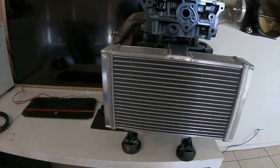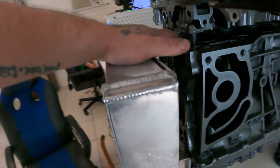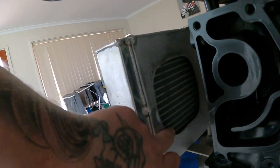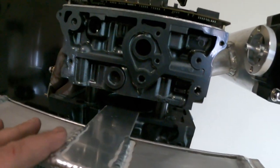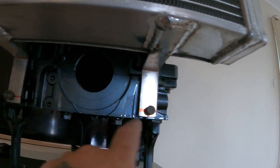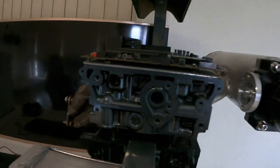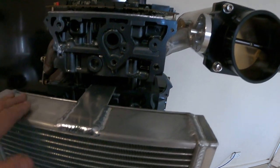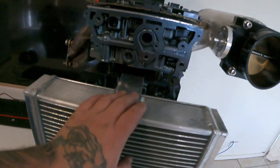The radiator is mounted up at the front — brackets sleeved on number-one cylinder. We've got the cutout ready for twin fans, brackets welded all the way around, and two brackets on the bottom bolted to the block. I'll smooth out the bottom corners and get it painted the same color as everything else. The quarter-inch fittings are tapped out and ready to go.